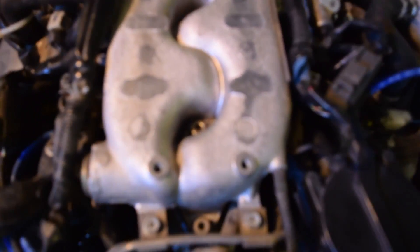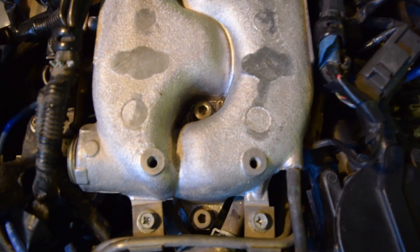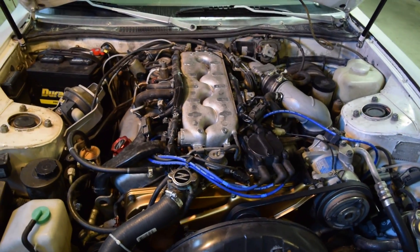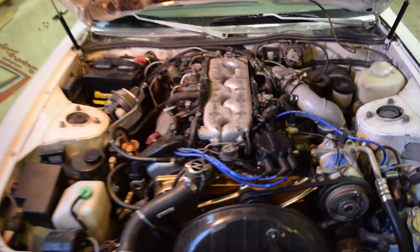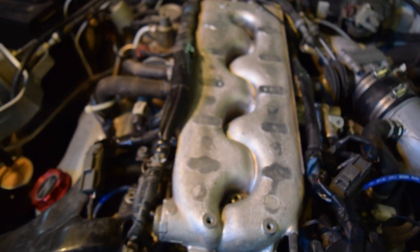You may notice I took off this little nameplate right here, and that's because these bolts in here — right in there — those are what hold it down. And those are notorious for getting stuck. So the first thing we're going to do is grab some WD-40 or another penetrating fluid and go ahead and soak those down there, just so that we can get it nice and ready to come off.